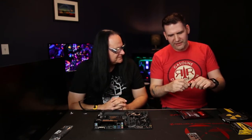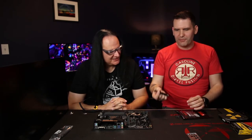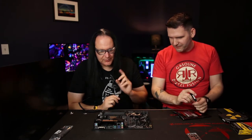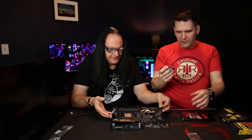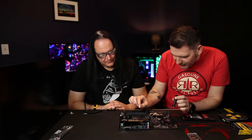Okay, yeah, all right. The first thing about thermal paste is you have to make sure it's good. It's an excellent bouquet, if you would like to do the taste test. Okay. So there are a couple schools of thought on this. One is you put a pea-sized glob right in the middle. That's what I was taught. And then you press the cooler down right on top of it. Works fine. There are also X's you can make and things like that. And then there's also a spread method, where you make that glob and then you very carefully spread it out, and you're not using any more.